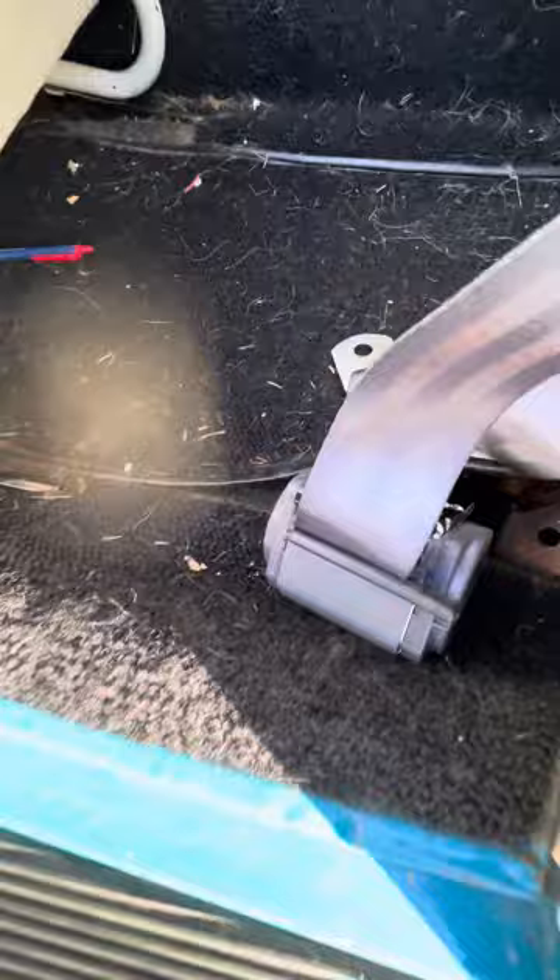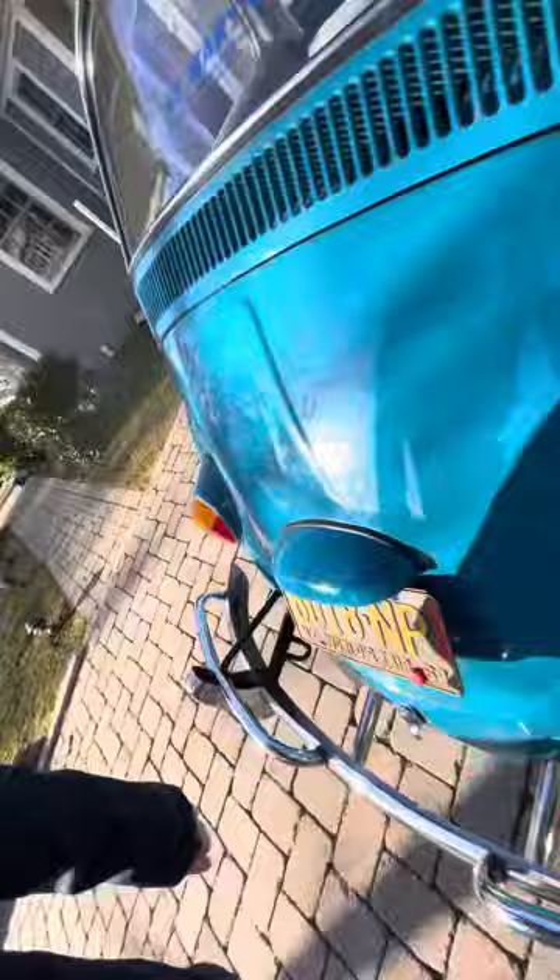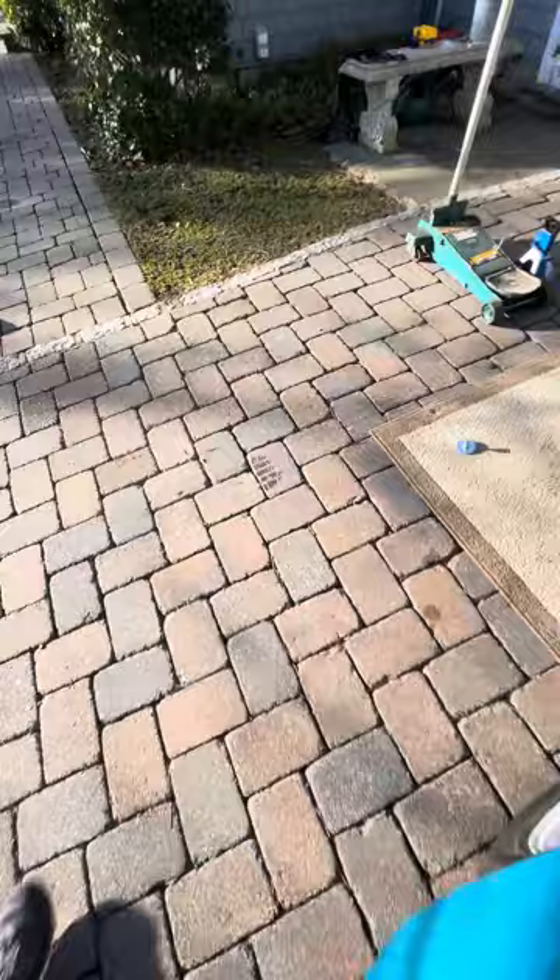I have to cut back this aftermarket carpeting and clean up the way this looks. But the bracket will go right on that screw, like it did over here. I think the extra safety is good. You do have to cut through the floorboard. I'll show you real quick what the bolt looks like with the anchor — there it is right there. I hope that solves a couple of mysteries for folks, because there was no real clear way to do it for a car without the point on the floor.